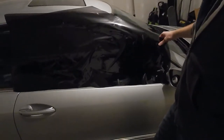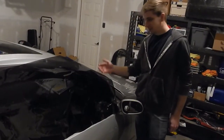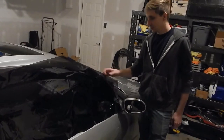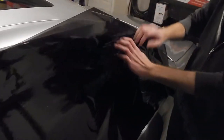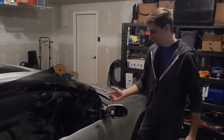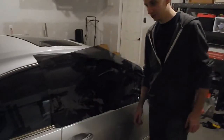All right, so I'm getting my windows tinted. This is my buddy Ryan. What's up? He'll give you a little one-on-one gist of window tint. Okay, so I hand cut all my film. To save a little bit of time, I'll cut the driver's side and passenger side at the same time. So I actually have two different pieces of film on here right now, facing opposite directions, and essentially that saves a ton of time. It takes me 20-30 minutes to cut a window, so doing both at the same time saves 20-30 minutes. And that's about all I'm doing right now.